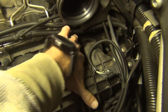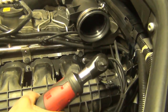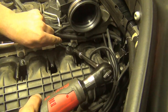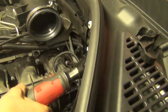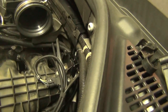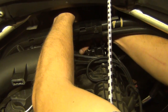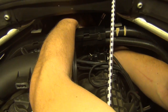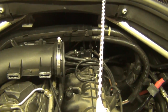Make sure everything is clean — you don't want to pull an intake manifold back and have something drop into the intake ports. There are two more in the back. This one's a little tougher, you have to go on the back side of the harness and feel for it. Once you're on it you'll find it, but it's something you really can't catch on a video — you just have to feel for it and then remove it.